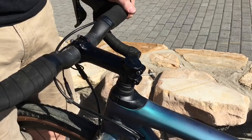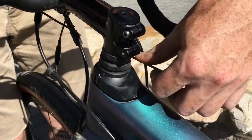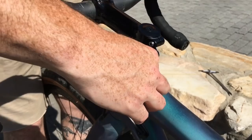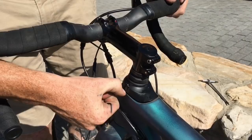The way the set screws work is there's a 2.5mm little lock nut on top of the set screws, just to keep them from backing out on their own. If you loosen those up on either side, you'll be able to see the headset rock back and forth — that's a loose headset. Going in with a 2mm key, the lock nut is a hollow nut, so you go straight down through it to the set screw and tighten those down. That puts downward pressure on a plate that's sitting on top of the steerer.